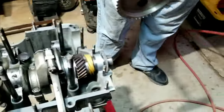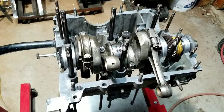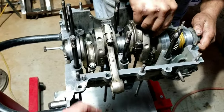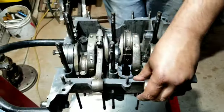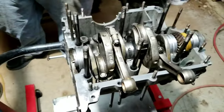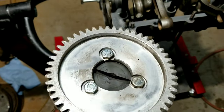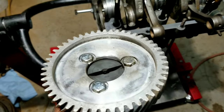Ooh, the 268 is going in here. This is a good cam, by the way. If you're looking for a cam for a 1600 to build a cheap engine, and you're going cheap on everything else but putting a new cam in it, I would always go performance on the cam, always. But if you do that, the Web 86 is a good versatile cam for this engine. I think you could use an Engle 100 as well, but with the Engle 100 with the ratio rockers might be a little bit too much cam for a 1600.